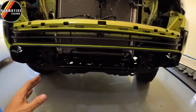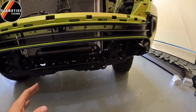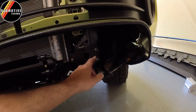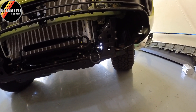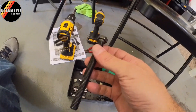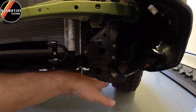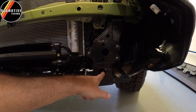It's time to put the bumper on and bolt it down. You needed to save six of the nuts that you took off of the crash bar — they're going to hold the bumper on through the studs that go through the bumper. Let me grab the bumper, we'll get it on, and then there's one more part: a long bolt that goes underneath. This is going to be threaded through this hole — I'm not sure which hole it is. We'll know when we have the bumper on there because we'll be able to see it.